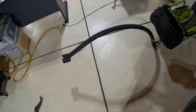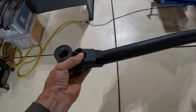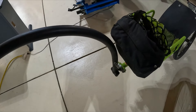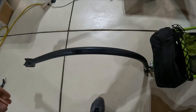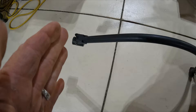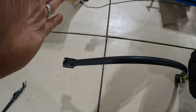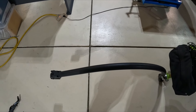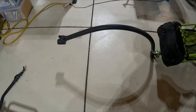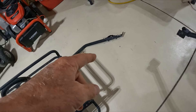If we come over to this one, this is the kind of pull bar that actually comes up and hooks onto your seat post. This goes around your seat post, and the whole trailer follows you. What I really like about this is that it rotates on the seat post, and your bike can literally do a 90-degree turn relative to the trailer. If you've gotten into a jam and need to turn your bike around, you can even go more than 90 degrees, and it'll turn around and follow you. That's a big advantage — you don't have to watch right-hand corners like you do with the axle-mount pull bars.